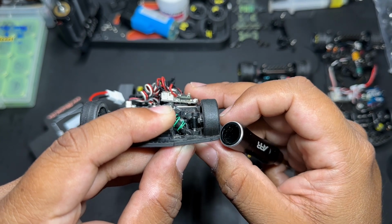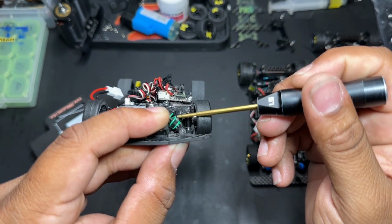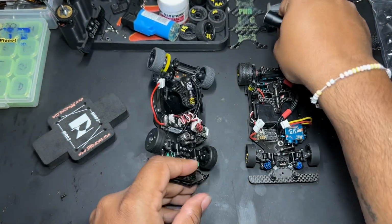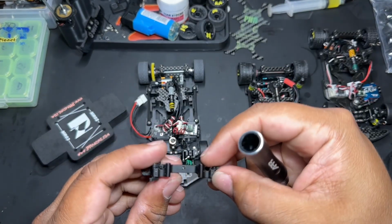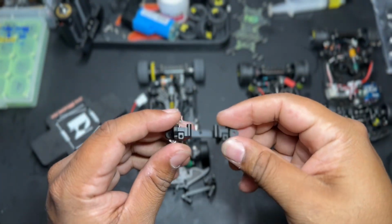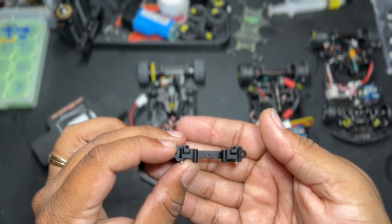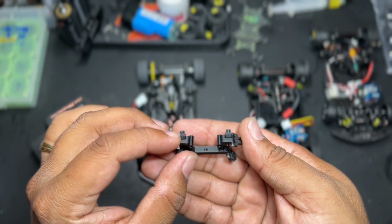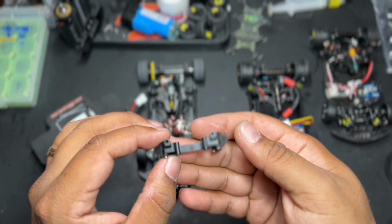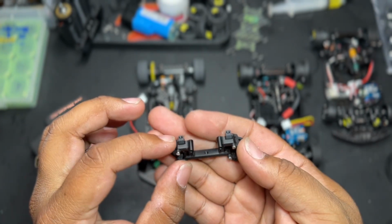And what people seem to do is adjust it with the collar or the front shock to get the ride height that they want, which is a very common mistake, like they used to do in the old days. What people used to assume and want to do is adjust ride height with droop screws that were right here. Very, very common mistake that people did, and it caused a lot of binding and people not liking the car because they thought this was the adjustment, which is not.